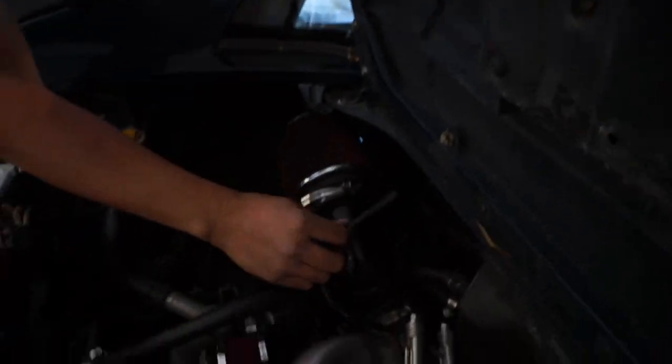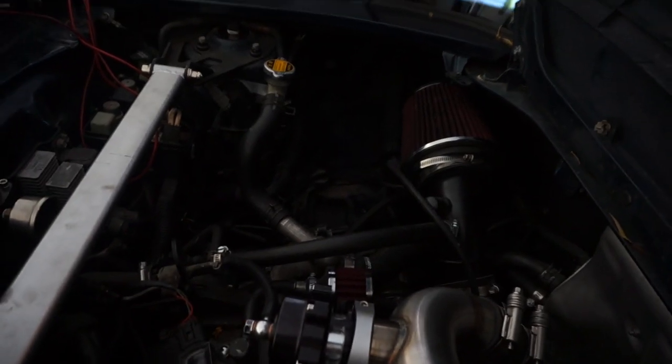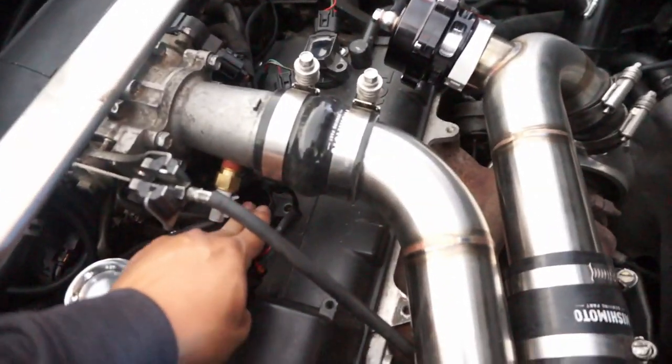There we go — seems like it's running. It has a little misfire. I hear something open — it's a vacuum line — it's my boost controller. There you go — so much better. What happened was I had to switch some wires around again. I put the wrong two and three in the wrong spot. So now it runs and we're going to have lunch. She runs, she's good. Thank you for watching, and until the next one.